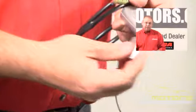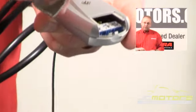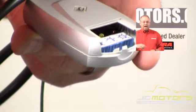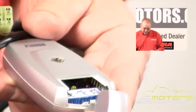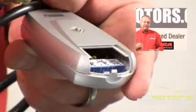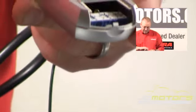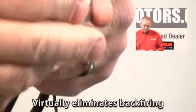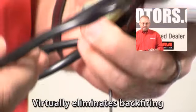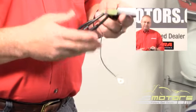There are three dials on here, and they work just like a carburetor. There's your air mixture screw — while the motorcycle is running, you can turn this screw and you can hear the RPMs pick up or go back down. The middle adjustment is like the needle and jet, and the pot over here is like a main jet. Every time you go up, it's like going up one size on a main jet. So if you can tune a carburetor, you can tune this, but 90% of the time all you have to do is plug it in and go ride your motorcycle.